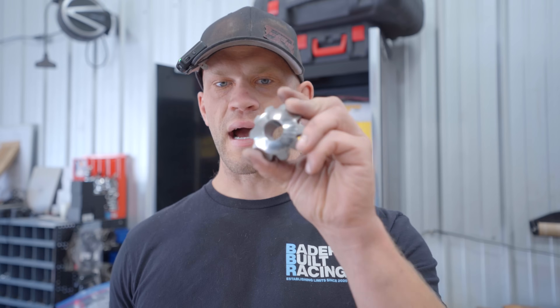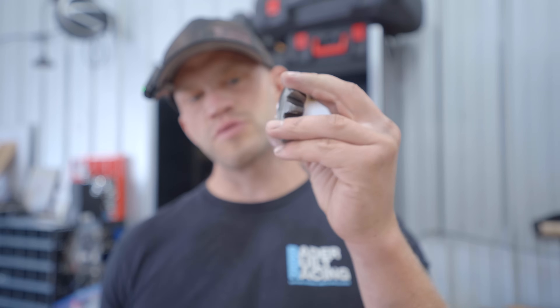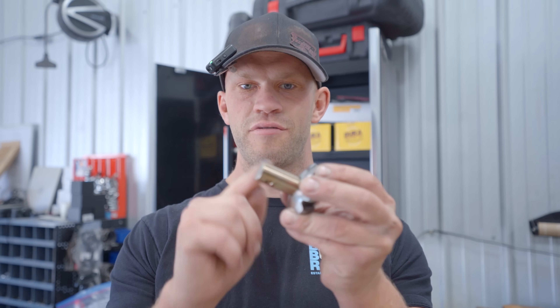Check this out — this is the gear that is supposed to spin freely on the pin. With a new pin, it doesn't even go through. We could probably pound it through and it'd be stuck, and this transmission would have lasted two minutes. Even with an old pin, same thing. I'm very, very happy that I was patient and waited for this new pin kit. We need to figure out a way to polish the inside of these gears — some sort of sanding drum. I'm going to run to Harbor Freight and find a drum that fits down inside the gear to get it polished out.